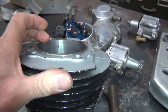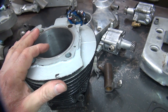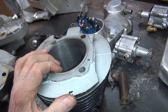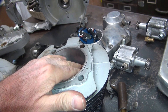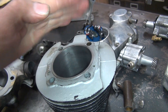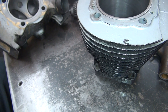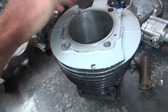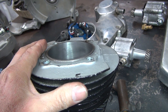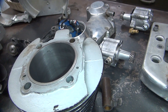The next thing is your cross-hatch angle. This is a fairly steep angle — steep angle is what you use on a long stroke motor, because piston speed is so fast going up and down you need oil on the piston to keep it loose. A Japanese bike with high RPM but a short stroke, the piston speed isn't that fast, so they run a flatter angle — too steep a valley drinks too much oil. Harleys and Porsches love steep cross-hatch angles because they both have crappy oil control. Modern cars run a real low cross-hatch angle because they're high-RPM applications. That's a lot of years of learning and going to seminars, talking to people who've been learning for 30 years themselves.